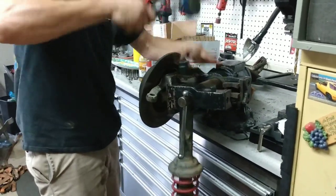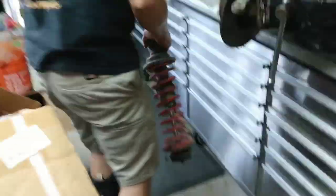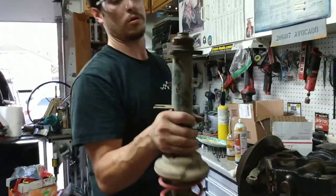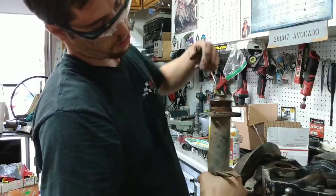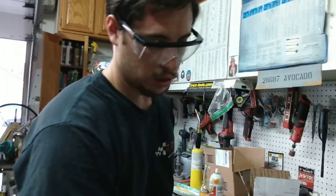Took a bit of hammering. Oh, shit. But there she is. Finally! Woohoo! And look, you can see it soaked through almost all the way around with penetrating oil. This probably took about 15 minutes worth of hammering and penetrating oil and heat twice until it's flaming, and then when you blow out the flames, it's steaming.